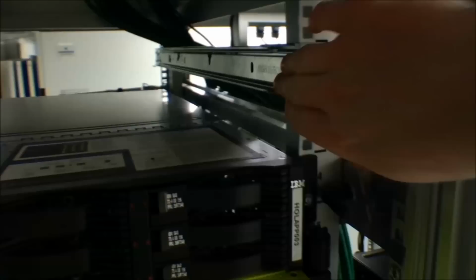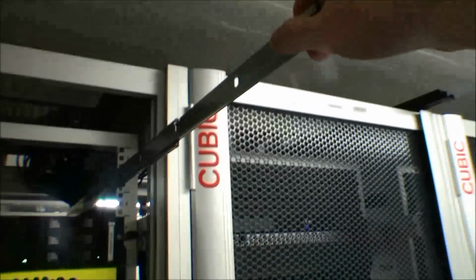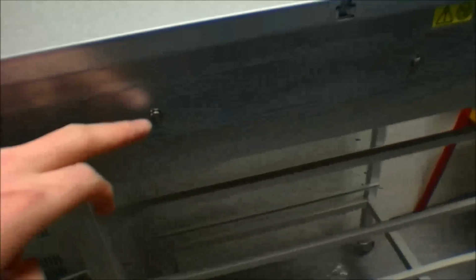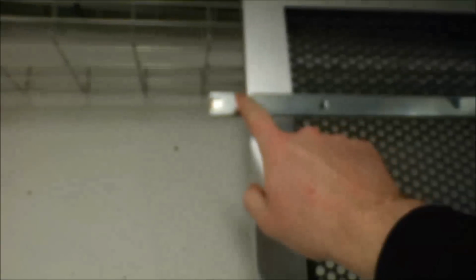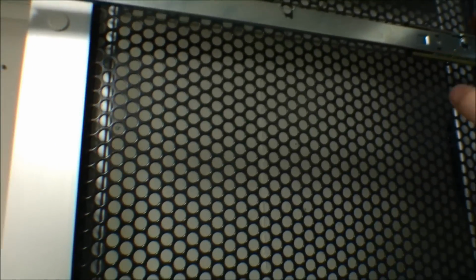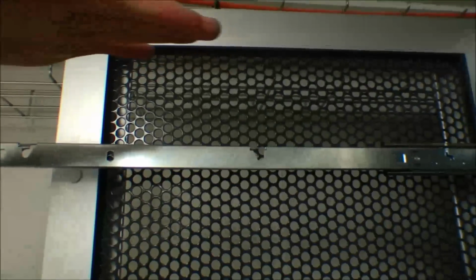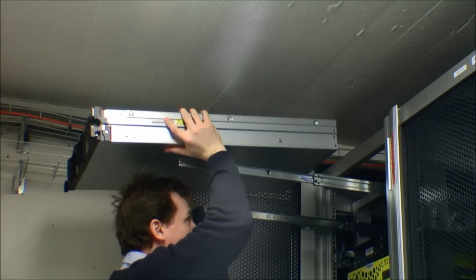And when you plug in the server, you take these out all the way. And on the side of the servers, there are some mounting brackets. There are 3 of them down the side, and they fit down in some slots there. The back end of the server has to go down first, which I'll try to show with my hand here. Go down and click. It clicks into place, and then it locks down.